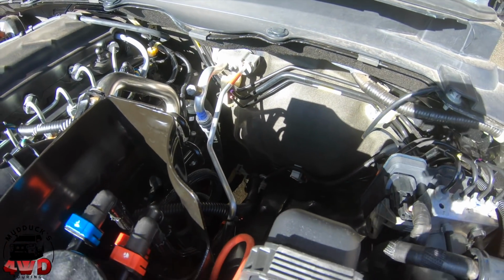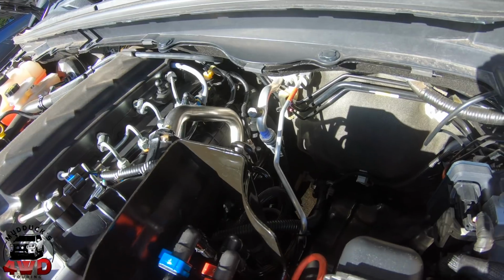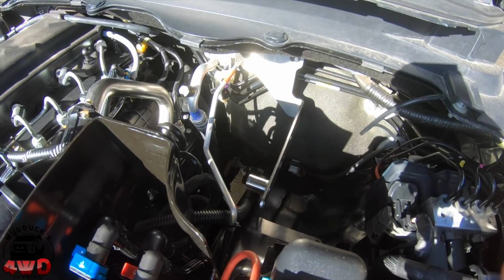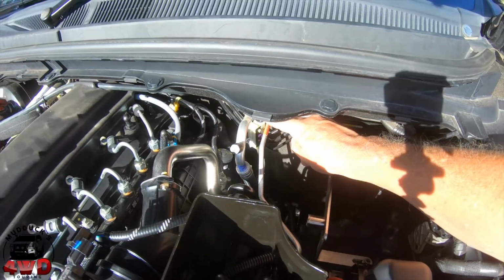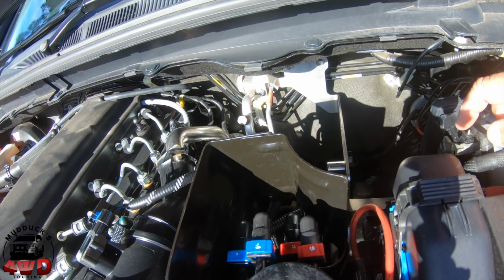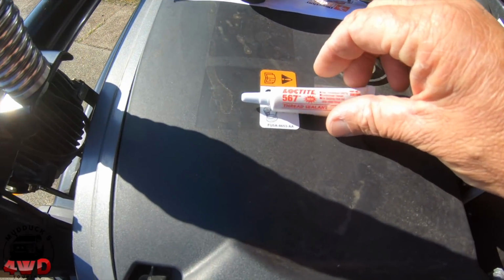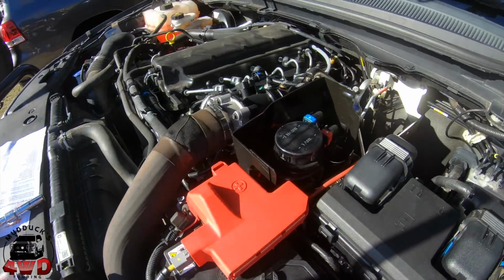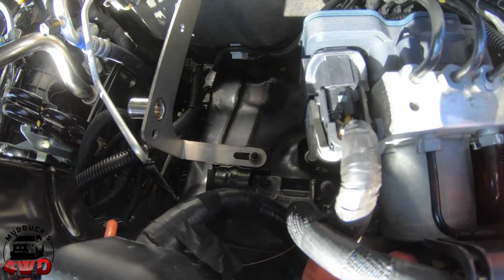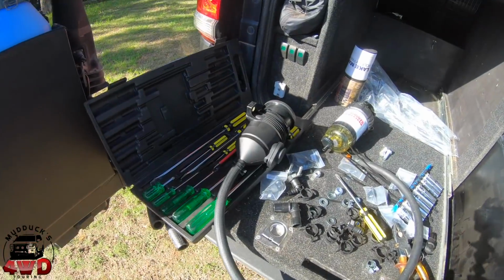So I'm going to bolt the bracket in, and I can't film and bolt at the same time, guys. I hope you can appreciate that. I'll give you a look at it when the bracket's bolted in place. Alright, well, after fiddling a bit, I still don't know how well you can see that. There's the nut down there. I was going to put a washer on it, but there's so little thread there that I went away from the washer. I used what they suggested and stuck a little bit of Loctite, Loctite 567, they provide with the kit. So I Loctited that in, and I've bolted it down using the original bolt down there. So there should be no reason why that doesn't stay. All nice and solid.